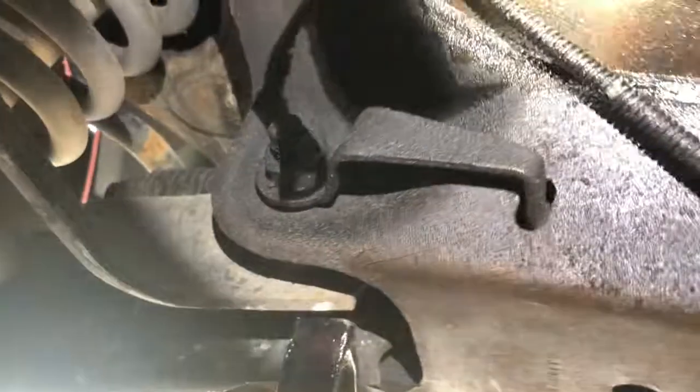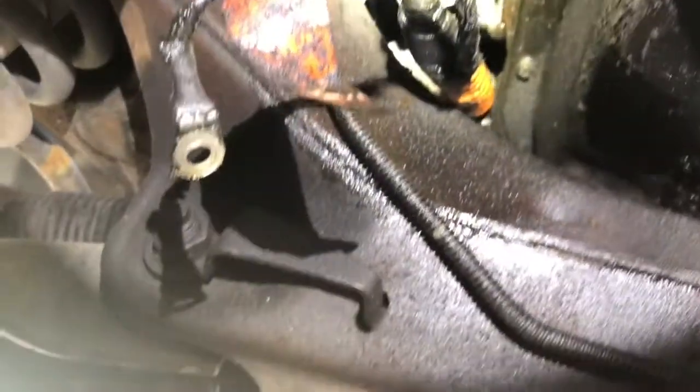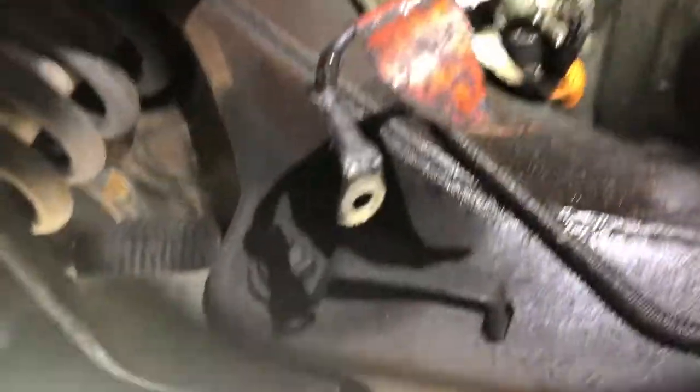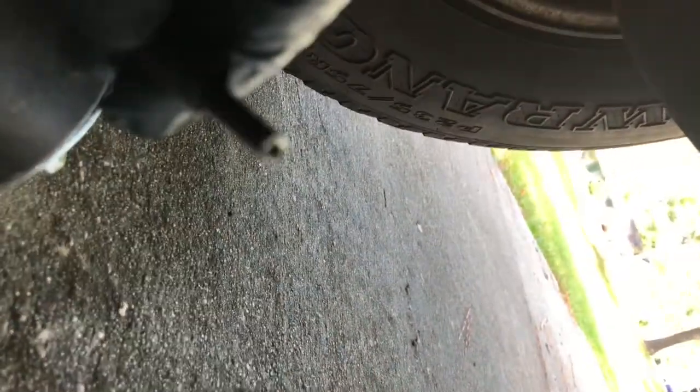It's a little nasty. My mechanic friend told me that eventually that oil leaking on the starter would trash it — that was about two years ago. I'm contemplating whether to use this wire. The new starter comes with a new wire but you have to crimp it and heat shrink it onto the old one. I think I'm gonna do that just to keep it all new.